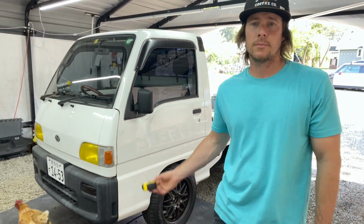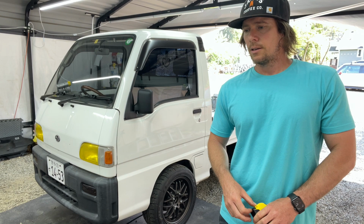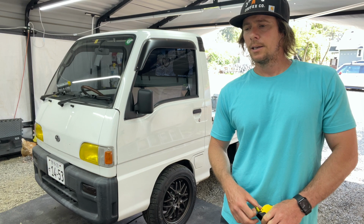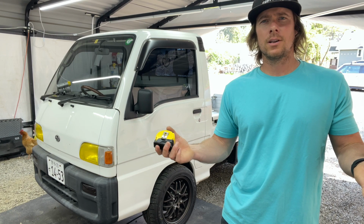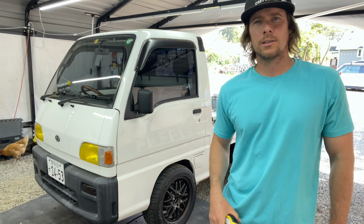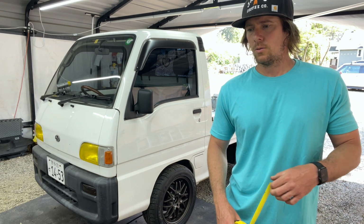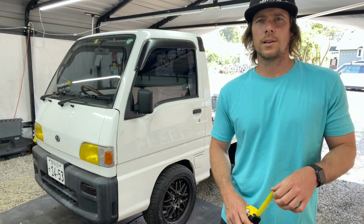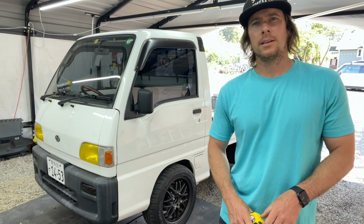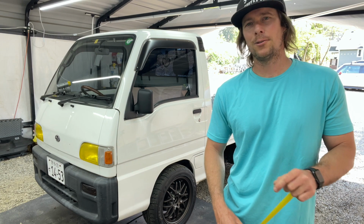So yeah, I just measured it, so I'm about a 1/2 inch lower on the driver's side. It'll be interesting to see what these white springs end up doing. I tried to combat that situation on the green van. I switched sides with the coils and it was still crooked. So I don't know. Maybe it's a funky design, or because mine are lowered, but this guy's I think was on stock suspension, so it's not just a lowering thing. I'm not really sure, but they do sit crooked. At least mine sit crooked, and that other person sat crooked who made the comment.